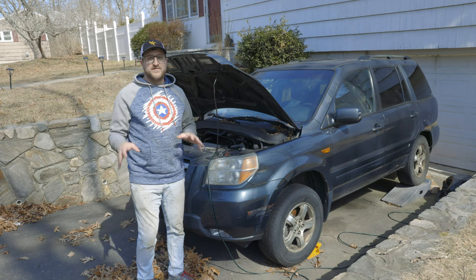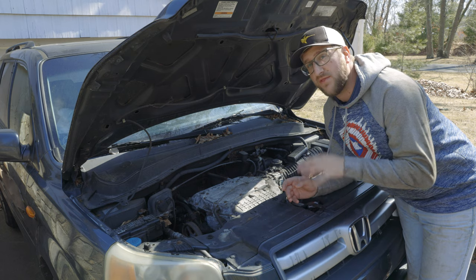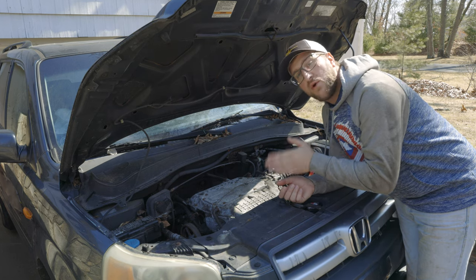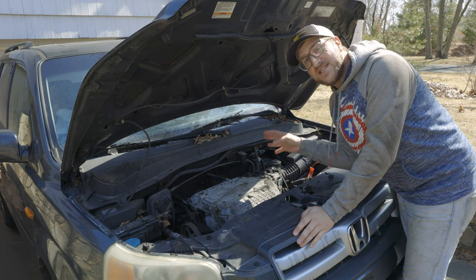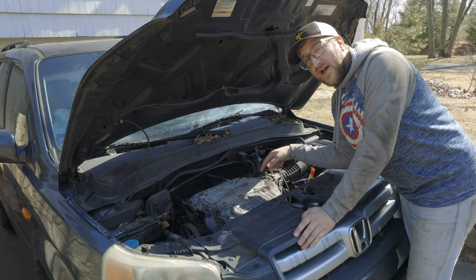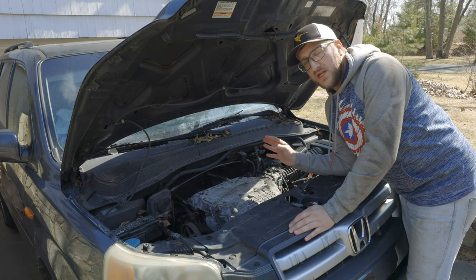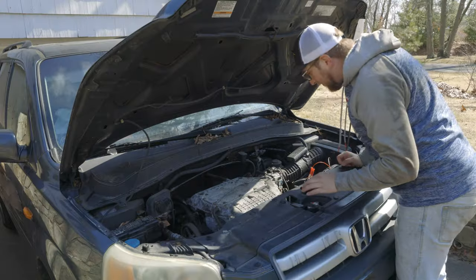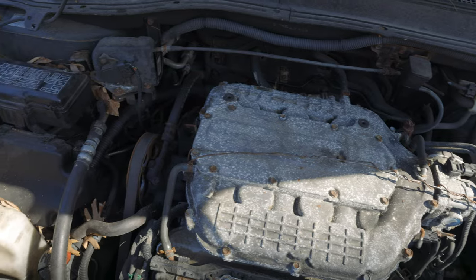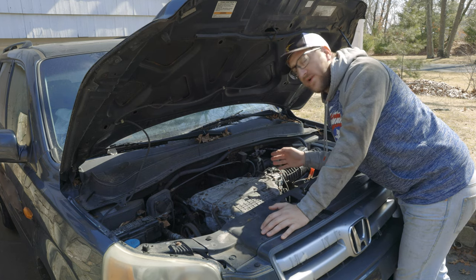I haven't installed that yet, but first we're gonna see if this cranks over properly and then pull it out of the driveway. There are a couple other things that viewers thought was wrong: a couple people thought it could be the injectors, someone said it could be the VTEC solenoid — there's an oil screen there and it could be clogged up. Another person said that because there's such a massive exhaust leak on this car — there's literally no exhaust — it could have burnt the valves, leading to a compression leak. With exhaust leaks, sometimes your engine can run really lean. It could be a combination of all these things. The mass airflow sensor could be bad, the intake boot is pretty crap, and the O2 sensors are probably scorched. Overall, I think the ECU is just getting a lot of mixed signals as to what the air-to-fuel ratio should be.